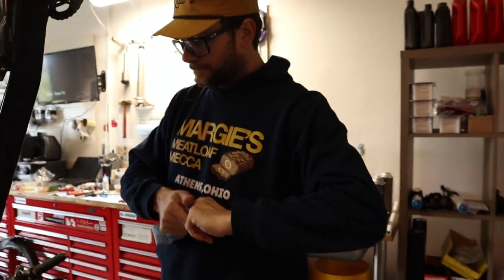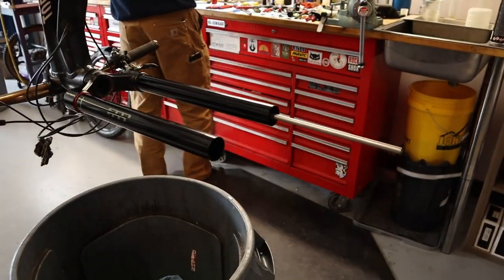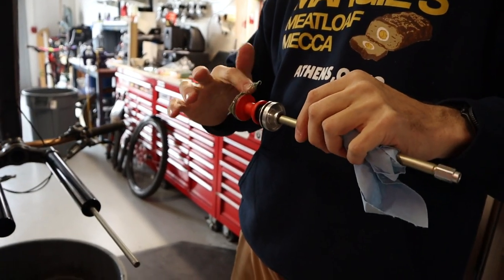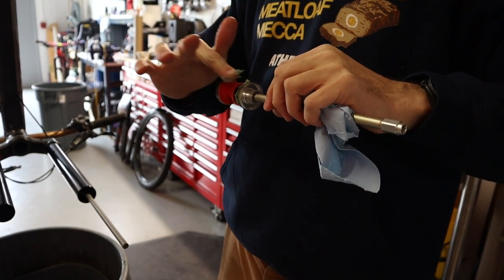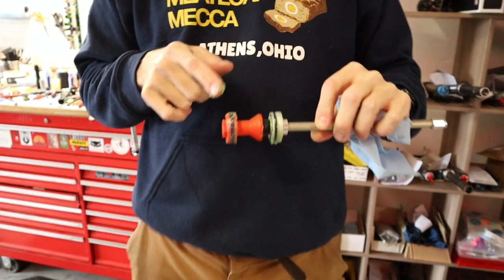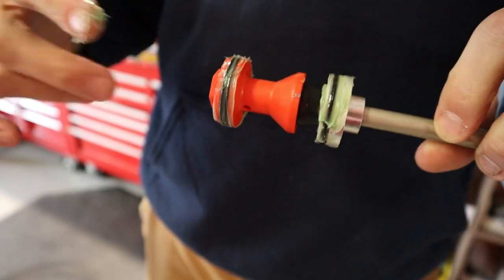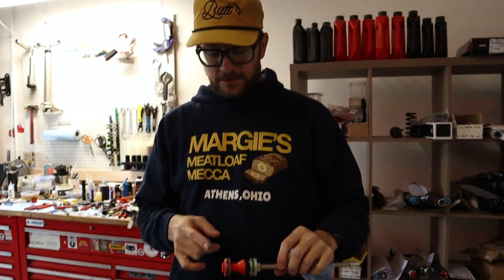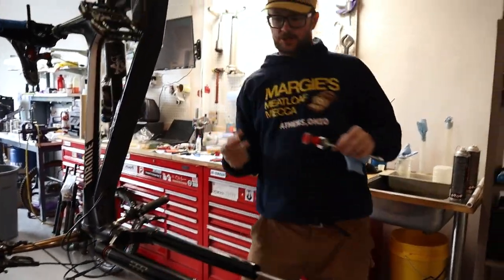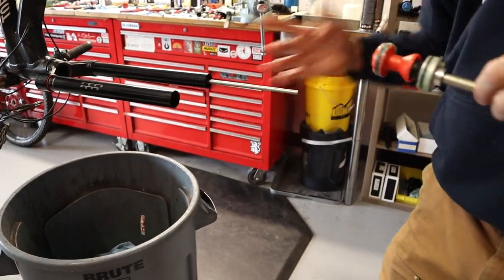See if you can get an angle of that — it should be shiny on the inside. I also make sure and clean the outside. You don't want to put a fork back together with any dirt. You do not need a ton of grease on this. Grease up both the O-rings — sorry, the quad ring and the O-ring. I've already pre-greased the shaft. But if you get a bunch of grease down here, you're filling the negative chamber, which gets rid of your suppleness. It's not the end of the world above, but especially if you pack the whole top of this thing, it's going to work its way down into the negative chamber. So you don't need a ton.